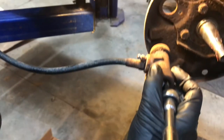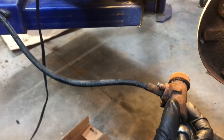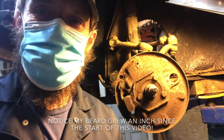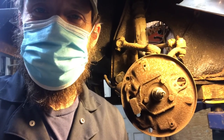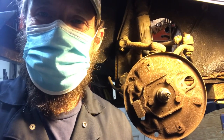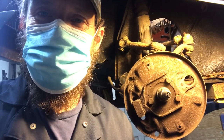It's an ATE brand — it's probably original. Well, we're saying goodbye. No sentimental feelings for old brakes. It's not much of an upside, but because of COVID-19 I've got this mask handy — great, because I'm going to wire wheel the backing plate now and clean off some of that rust and scale. Not so it looks pretty, but just so that the brake shoes have a smooth surface to run on. We'll get that cleaned up and start putting the brakes back together.